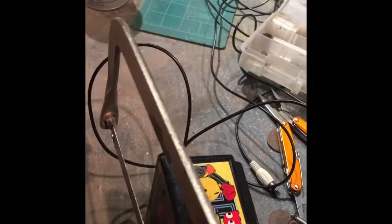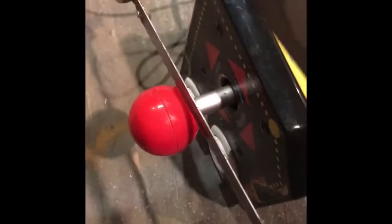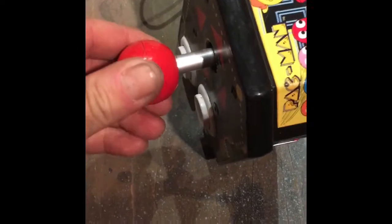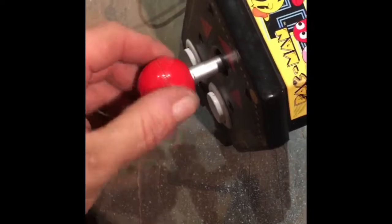I think I put this plastic case part in a vise before. And then I just grab the saw and cut the ball off, and hold the ball as a grip while you're doing it. So this part is in the clamp and you're hanging onto the ball with your hands and carefully cutting off that way. It's a pretty hardened piece of steel in there, so it's a bit of a labor.